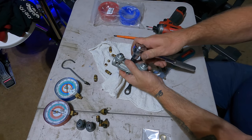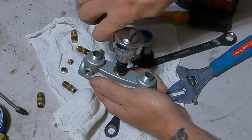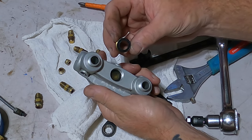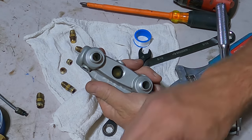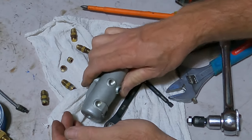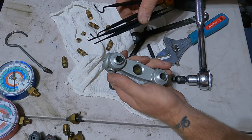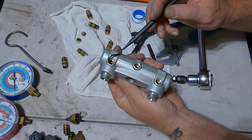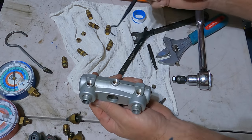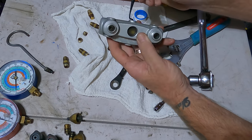Let's go ahead and see if this will break free — I don't even think it's in there that tight. Look at that, you could break it free with your ratchet. There's the retainer with the first gasket — inside is our sight glass. This will probably get interesting. I'm gonna have to grab the pick set. Another thing I forgot to mention is I do have a pick set. Inside all your ports for your hoses are these little screens — there's little screens in there. If you remove the screens you can get your pick set in. I'm just poking away at it.